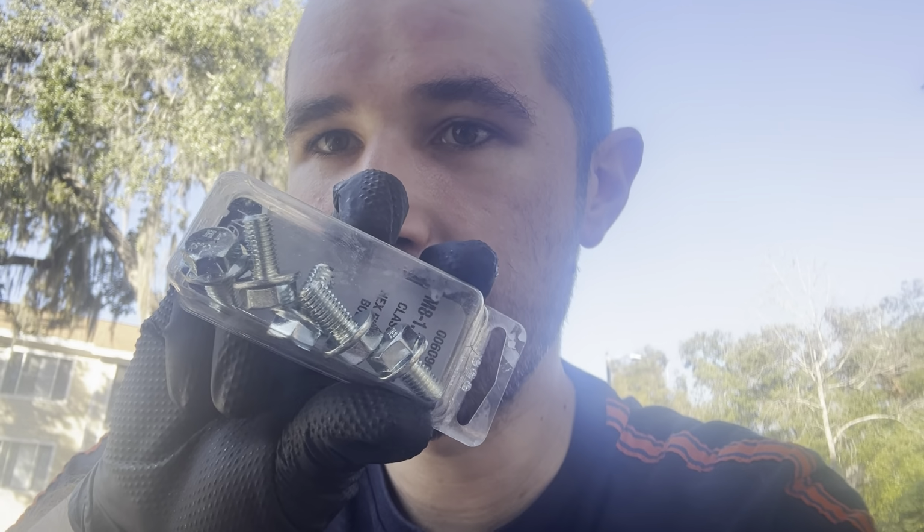So I went out and got some bolts that are the same size as those studs, and today I'm going to be taking off my wheel, removing those studs and putting in bolts instead. So from now on, every time I go to take off my sprocket, I'll be taking these out fully, taking the sprocket out, and then doing what I need to do with it.